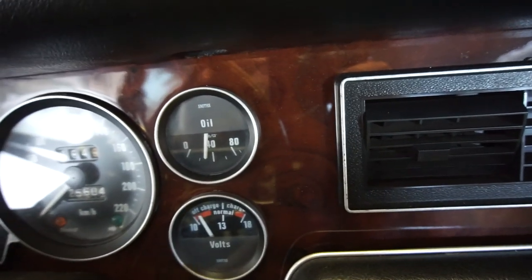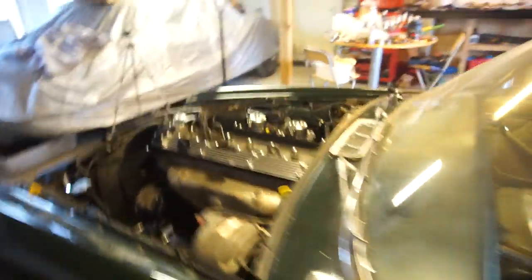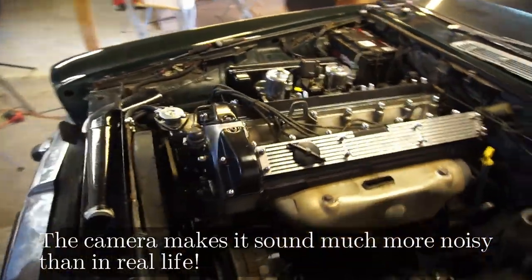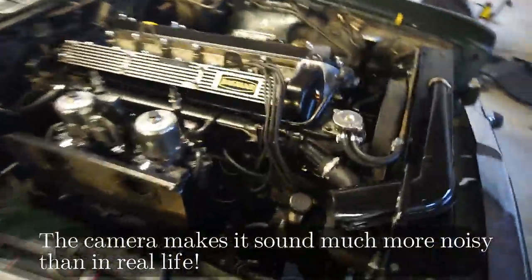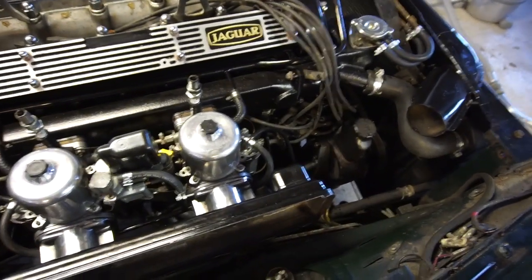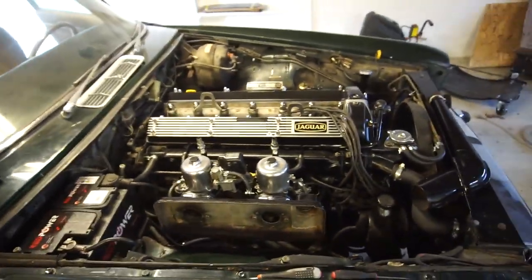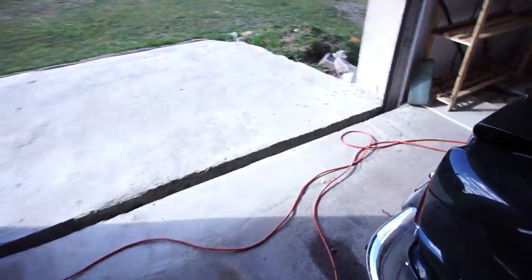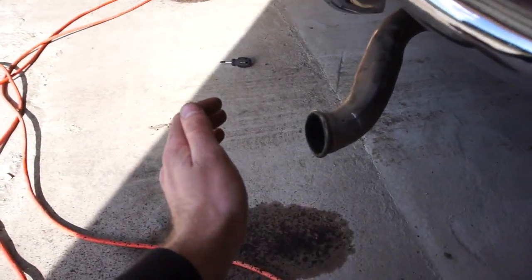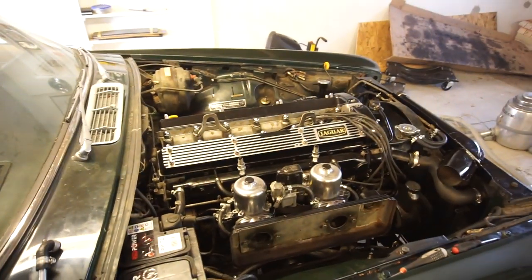It is building oil pressure — coming up a bit slowly — and temperature is starting to rise too. There's a bit of coolant coming out but I'm hoping that after I re-torque it that will stop. Other than that it sounds really nice and strong. You can see the exhaust; it made quite a mess when it was running very rich, but it has very strong exhaust pulses — at least it feels like it has a lot of compression. At least it's finally running.